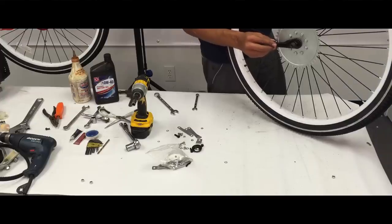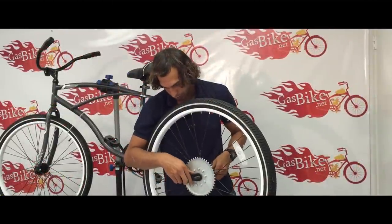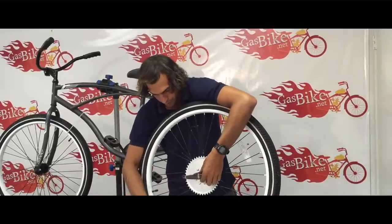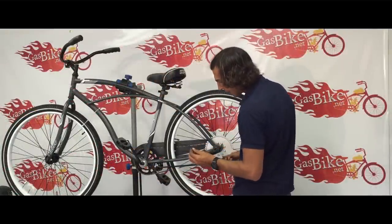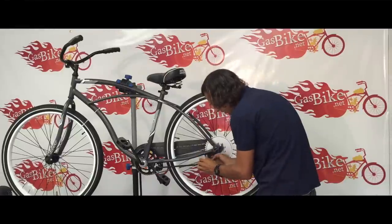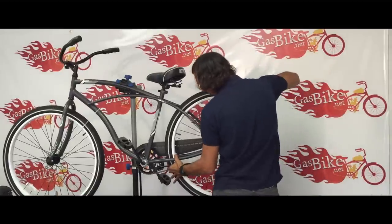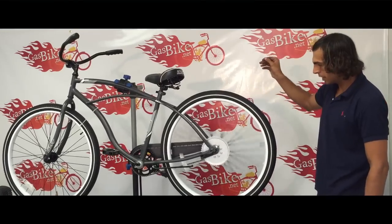Make sure that when you go like this there's no play. As you can see, we have some play, so just tighten it up a little bit until you don't feel that it has any play anymore. Now reinstall all the parts. Usually the screw goes in that way, but since we have this chain here, I recommend putting the screw in from the inside so there's more room for the chain. The nut is going to be on the outside. Once you have that tightened, at least by hand, you can go back and start tightening the wheel. Okay, now the wheel is installed.